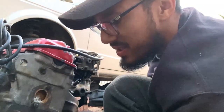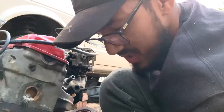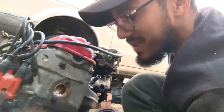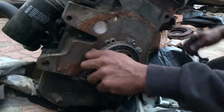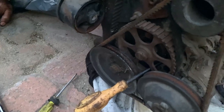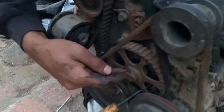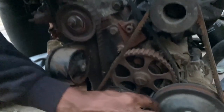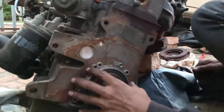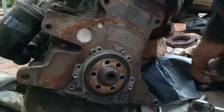We used two power bars to get it off. How many nuts? I think it's 6. We took 5 off like that. 2, 4, 6, yeah. We just turned them in opposite directions. And then the very last one, I stuck a flat screwdriver in on the... what pulley is that? Anyway, on this specific pulley here, it runs on the cam belt, shoved it in there, and it pretty much pinned up with these two pulleys, which gave some sort of fix for the last nut to come out. And this is what YouTube don't tell you. Yeah, when you search.